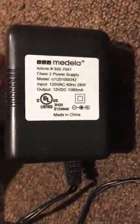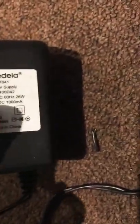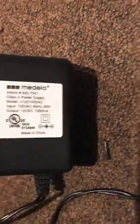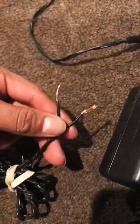Okay guys, so I'm gonna show you how to test the radio out of the car. What you do is you need to get an adapter. In this case I'm using a 12 volt DC 1 amp, 1000 milliamps. This one came with this connection and I just cut it off, so these are the two wires.